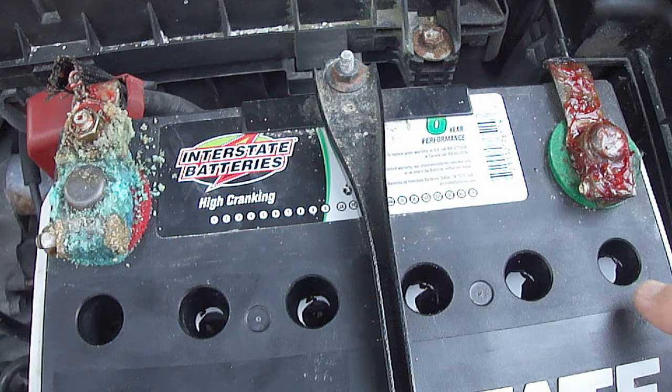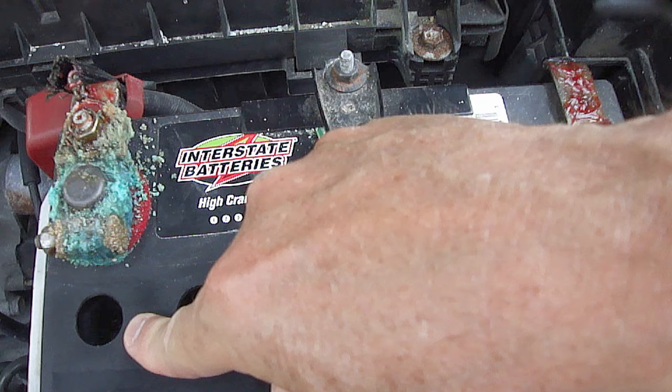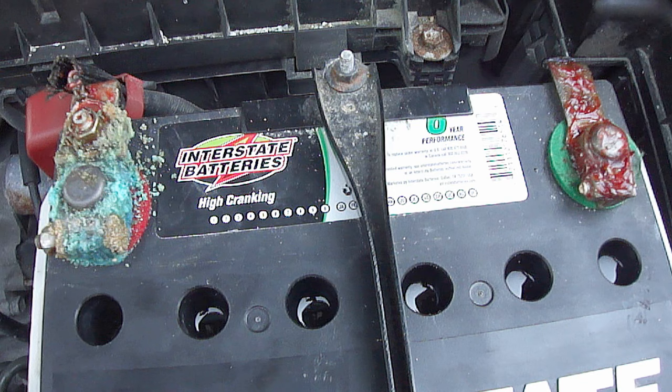With the battery caps removed, look at the water level in the cells — full, full, full, full, full, but this last one is losing fluid. Also notice the battery terminals. The negative side has no corrosion, but the positive side has a serious corrosion problem. While it's true that higher alternator voltage output can cause positive terminal corrosion, that condition will cause the fluid to drop evenly across all six cells. So this condition is different because it's only losing fluid in the one cell. Notice the cell that's losing fluid is right next to the positive battery terminal that's severely corroded.